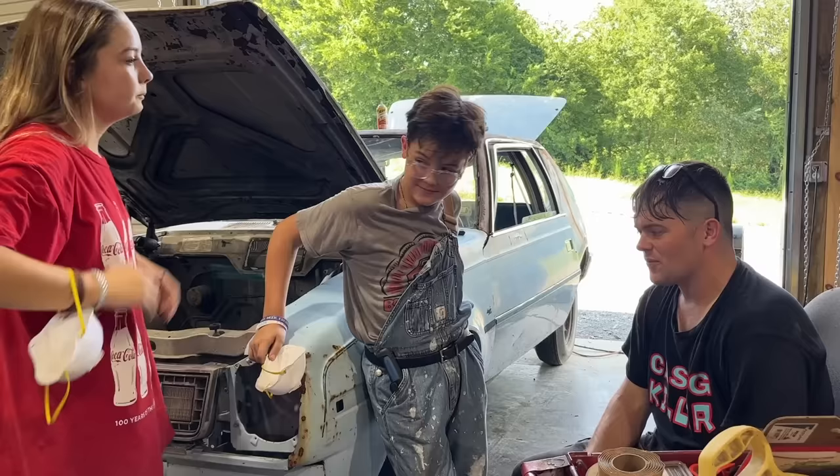Next day, we're back — some more sanding to do, some more brakes to do. He really took it literally — he's a good little sander. One thing the kids ran into that's a good example: you can see these runs here, you can feel them. If you sand in an X pattern and keep your block flat, you can sand those runs out of the primer. You don't want runs showing up underneath your paint. See how that run is kind of disappearing there? That's what you need to do.